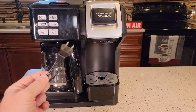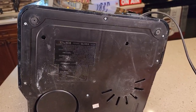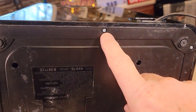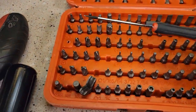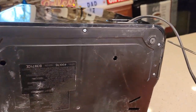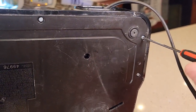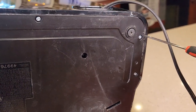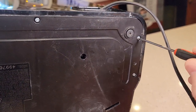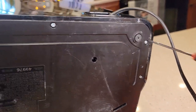The first thing we're going to do is unplug it, and we're going to leave it unplugged for the entire duration. On the bottom it's got security bits — you're going to need these security screws, it's like a tri-wing. I got this kit at Harbor Freight and the bit looks like this. In the past you can wedge a small straight slot screwdriver in there, but if it's not very stout it will just bend. Otherwise you're going to need this tri-wing bit.